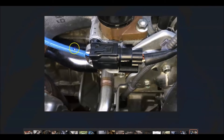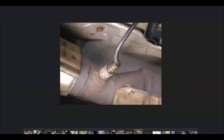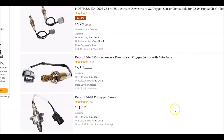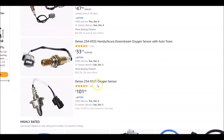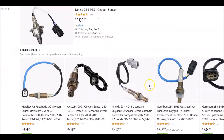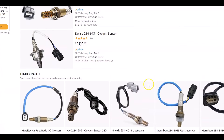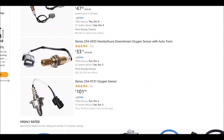If the wiring all looks good and there are no blown fuses, then very likely you will have to change out the oxygen sensor. These can't easily be tested, so most people just swap them out. Looking at Amazon, they're ranging around $50 to $100 for two of them, depending on the year. Most people go with the Denso O2 sensor, since other brands sometimes cause issues.